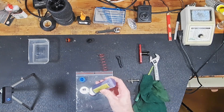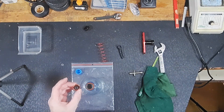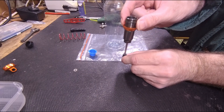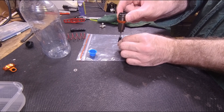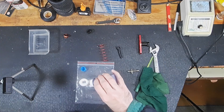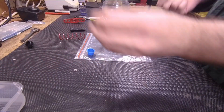So all I'm going to do is fill that shock all the way back up with the oil — to about there. You've got to allow room for the diaphragm. Then just ever so gently push the plunger up very very slowly, then pull it all the way down. That got rid of air bubbles. Give it a couple more drops and then just let that sit there for about half an hour so all the air bubbles can float to the top, then I'll screw the cap back on.